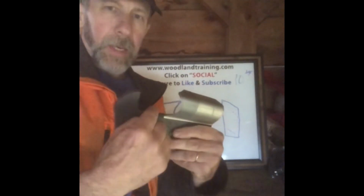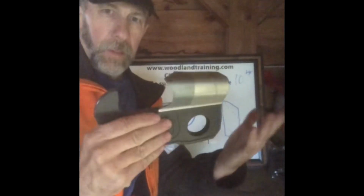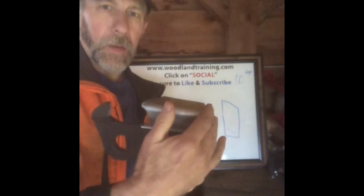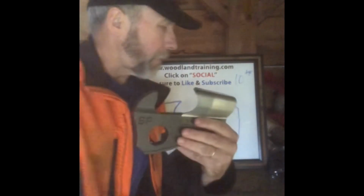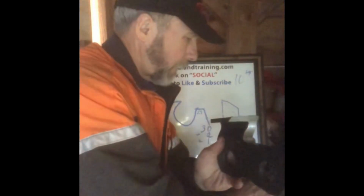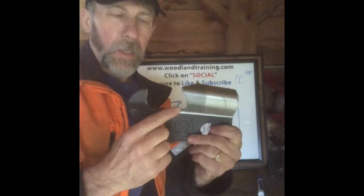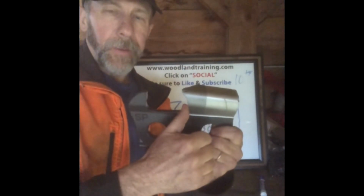So now we've square filed the chain, right? I know I have a round filed model, but you're with me in that we've square filed the tooth, we've cut the back off. Now this bottom, if you take that out by filing with a round file in the direction that you normally sharpen the tooth at, then we leave this whole side cutting edge with a sharp edge. No harm done, but let's think about what that sharp edge is doing.